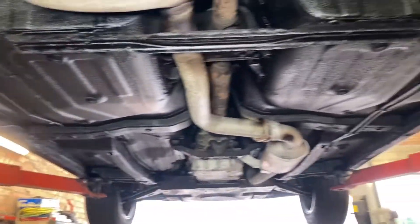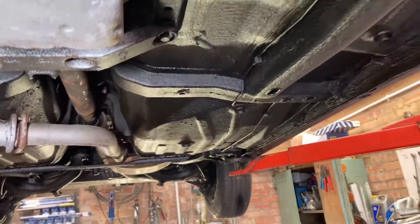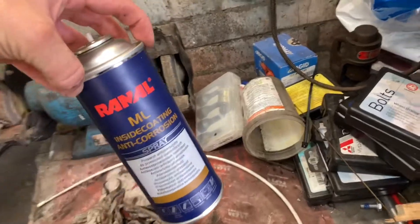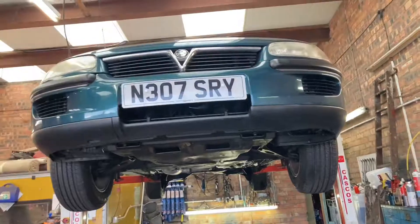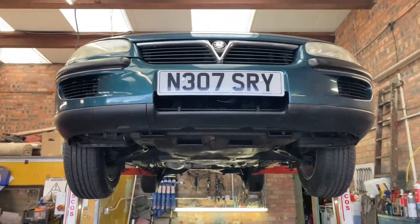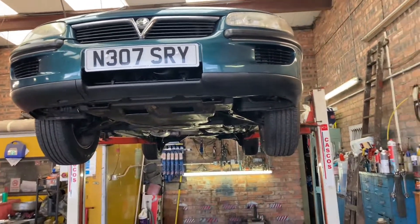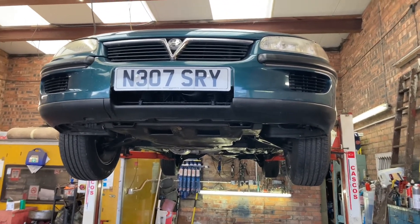While I'm saying full — I probably could spend a little bit longer doing this, I just simply haven't got time, and it's enough. Because this car's not going to be getting used over the winter, but unfortunately it will be standing outside. So for the sake of 5 litres of wax oil, it's had the full underbody done. That's the remainder of the cavity wax there with the straw, which I'm going to do in the bottom of the doors. So I'll catch you in another video. You've got to remember to get into all the little pieces, even right into the grills and areas like that in the wings. It will just give the car an extra lease of life, especially when they're in good condition like this one where it's never needed welding done or nothing like that. If you like this, like, comment and subscribe. I'll catch you next time. Bye.